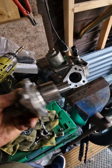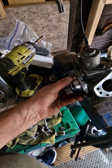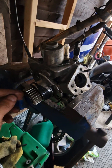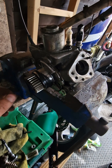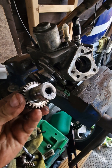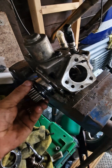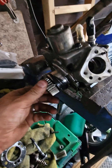So to summarise: fuel pressure regulator, spring breaking, and the cam losing its chroming which clogs your injectors. A rarer one that does happen — but less common than the others — is what happened in my situation. This gear attaches to your exhaust camshaft and spins the cam on the other side. That shaft snapped, completely sheared off on my car. This pump was fitted at 131,000 miles and I replaced it at about 196,000 miles.